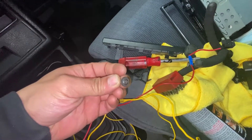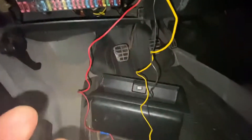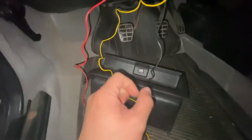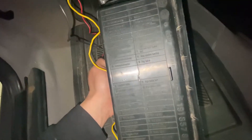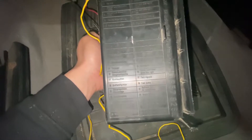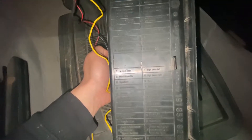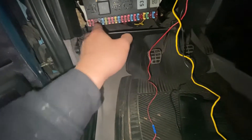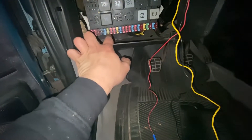The hardware is the same so don't stress about it. Now we have the wiring pushed all the way through. Looking at the fuse box, we're gonna go with number nine on the list — the rear defroster — since it gives ignition power. We're gonna count nine fuses and plug in the red power wire there, putting two fuses on it.